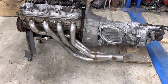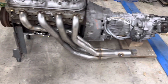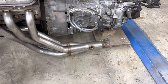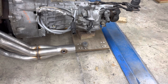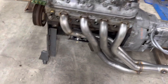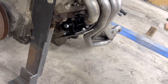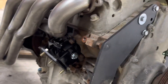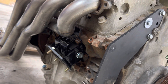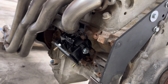Half my plan worked. The heavy-duty brackets for the front bolt onto the front accessory bolts and the water pump and are holding up fine. The rear brackets were fine when static but failed miserably when I tried to roll it. So we went old school — a dolly and block of wood — until we hit three degrees. Now the engine is set perfectly at the angle I want, and I'm putting engine mounts on and getting a plate that will be boxed to the frame.